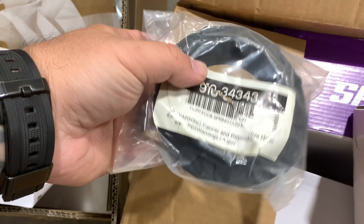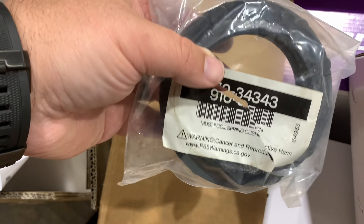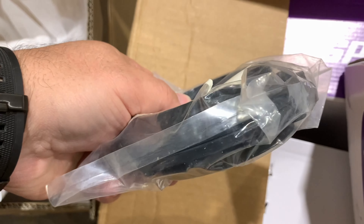Time will tell. I can't really say anything until we get everything in there. We are going with a heavier transmission too, so maybe that might make a little bit of a difference. Once we get it all mounted up we'll be able to make the determination if this is the right choice. I would have liked 400 or 450 — I think that probably would have been the right choice — but it wasn't available with this kit. It was 375, then the next step up was 500, so we took 500. Leave a comment and let me know what you think about spring rates. They also give you rubber coil spring cushions that go in the upper control arm — nice touch.